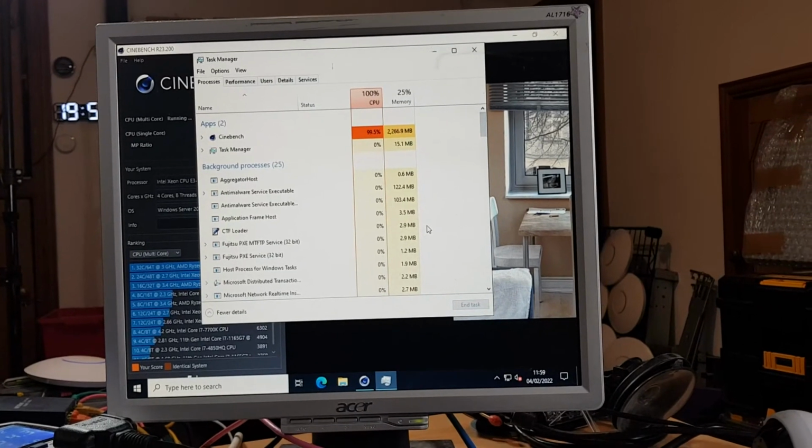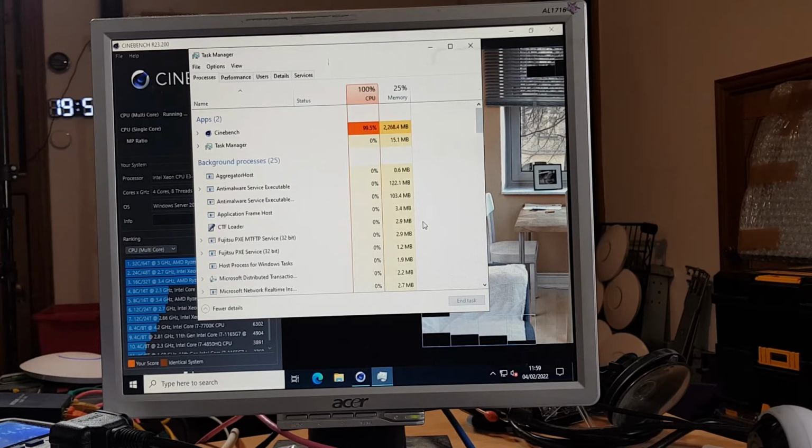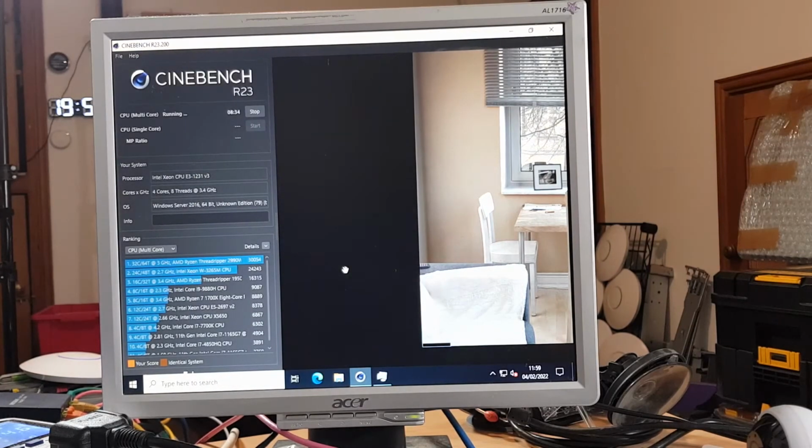But unfortunately, the cost of caddies, the fact that most of these are beyond poverty spec in terms of lacking backplanes, everything else, I would not actually recommend this as any form of Homelab server. They do make okay servers, or they did in their time, but far too many issues other than with the actual system. They have this annoying tendency, as I said, with the RAID card to drop the drives. Parts are pretty difficult to get hold of, well, here in the UK.